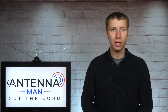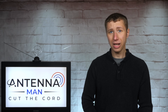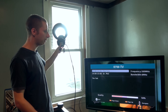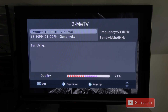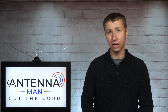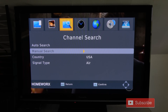With any indoor antenna, it's critical to use some kind of signal meter as a guide to find the best location for it. Moving any antenna as little as a few feet can have a huge impact on reception, which I demonstrated in a previous video linked in the description. If you plan on using an indoor antenna, I highly recommend the Mediasonic DTV box. It has a signal meter that comes up when you press the info button on the remote twice, which is very helpful to find the best spot for an indoor antenna.